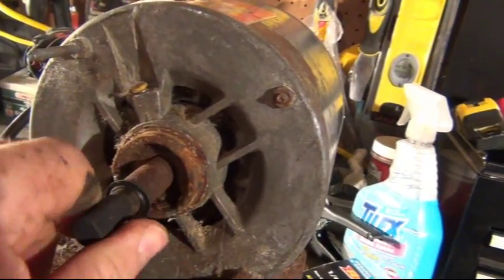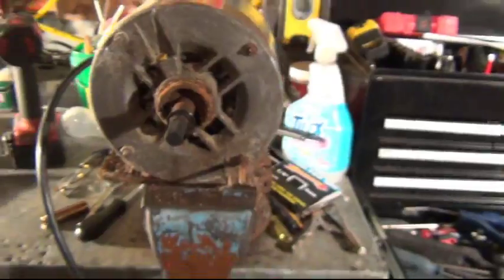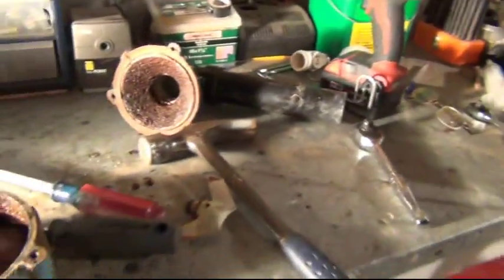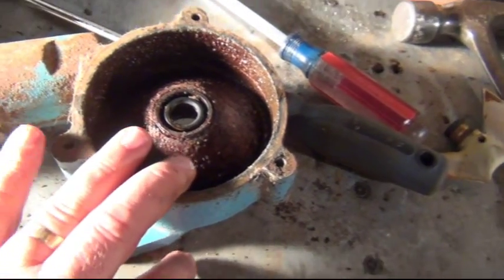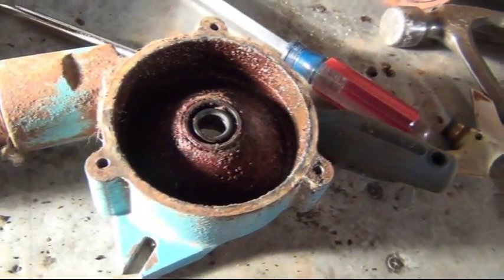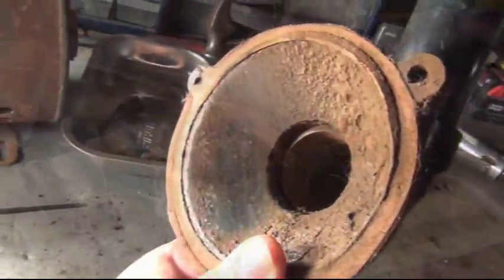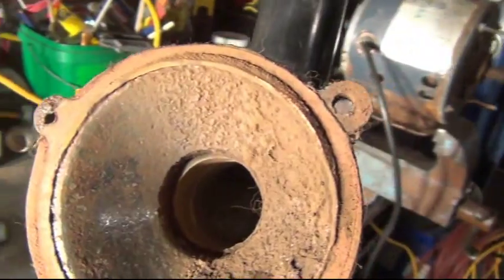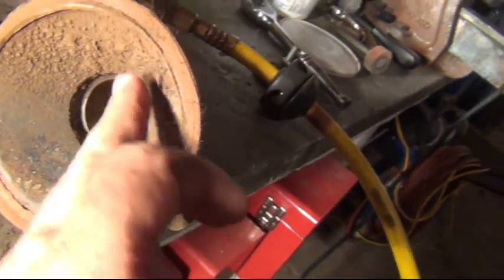It's probably clogged between the armature and inside too, but the bearing seems to be good. I'm going to open it up and check everything inside. It's pretty rusty down here. I'll start with the pump first, clean all that out. I'm going to use a wire brush with a drill to try to take that rust off. I'm cleaning the pump right now — you can see the difference here where I'm getting it clean.